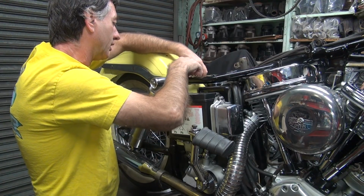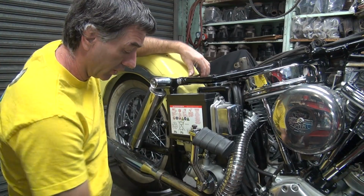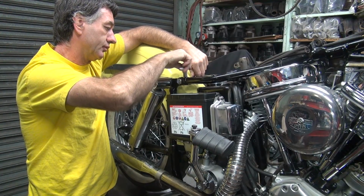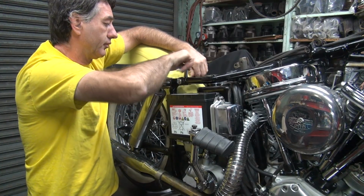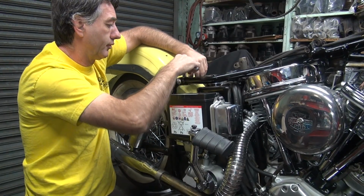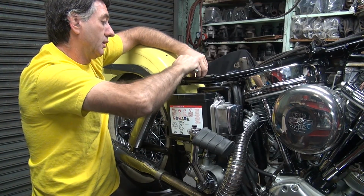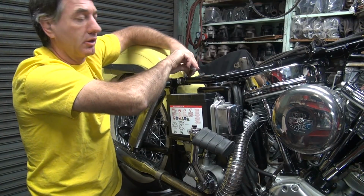You get that nice insulation on the cable, you want to make sure that is off of the frame. If it gets between the frame and the cable, you have to cut it, because rubber does not make good contact. So what I do is I put pressure on it, go back and forth on it, wiggle a little bit. Try to get a mark where it's hitting.